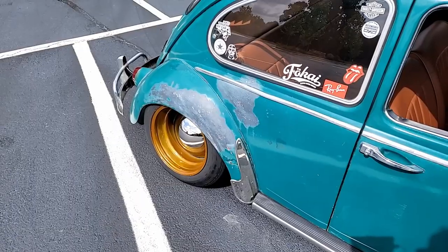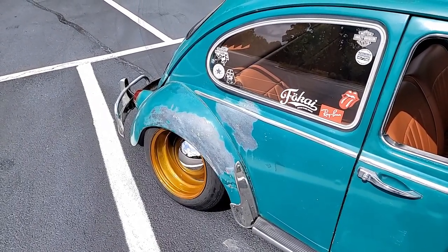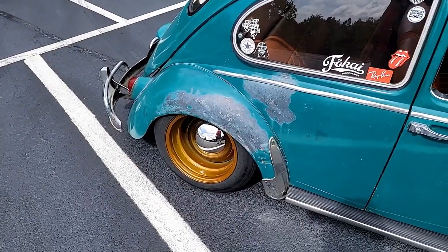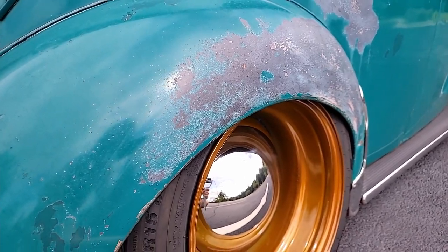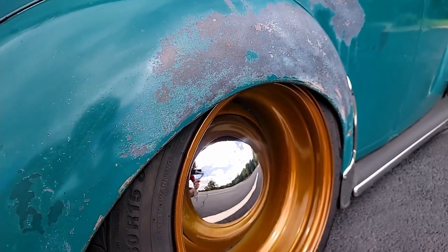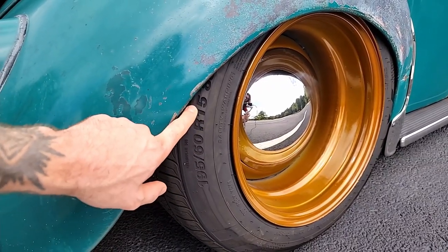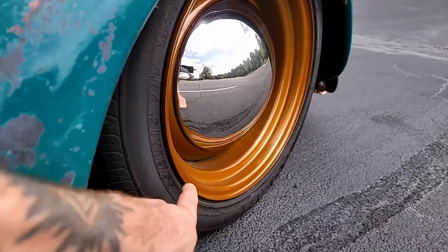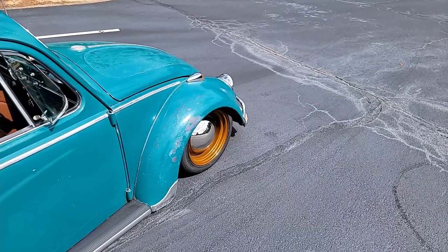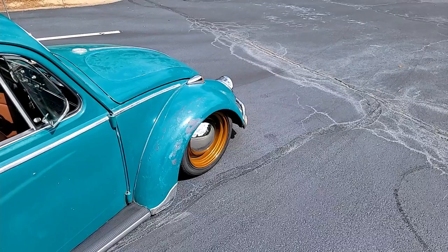The camber will. The rear wheels are 8 inch by 15 inch — they've been widened 4 inches. They barely fit. I had to roll my rear fenders to get the tires to fit, and even now you can barely get anything in there — it even rubs if you're too low. 195/60/15s in the back, 155/60/15s in the front. The front wheels are 5½ inches wide by 15s — they've been widened an inch and a half.